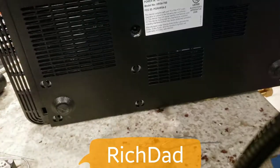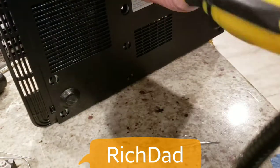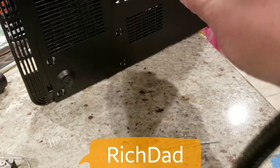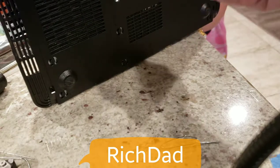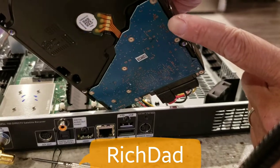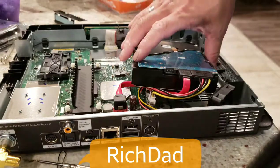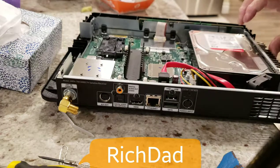I am missing a screw. One thing to be careful of is that the bottom screw hole is missing on the new hard drive compared to the original, so make sure the drive is as secure as possible. The first screw position is missing, and other positions may be missing on different drives. Put the hard drive back in and secure the heatsink.